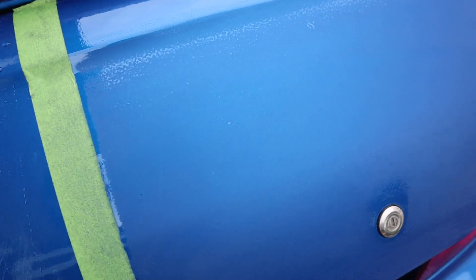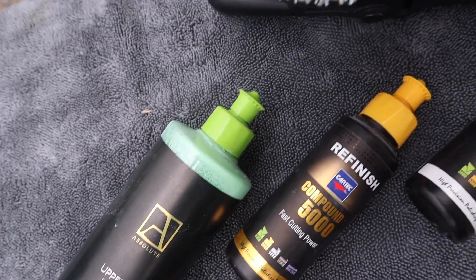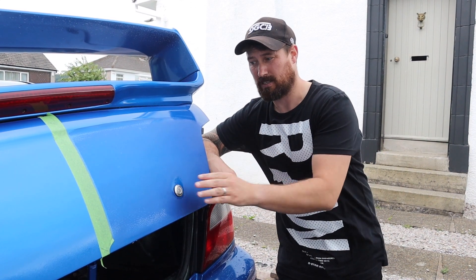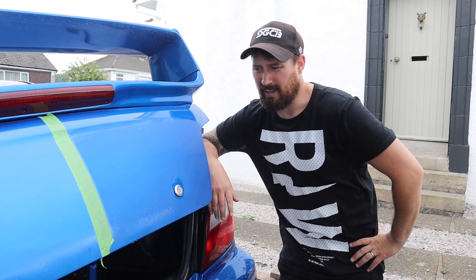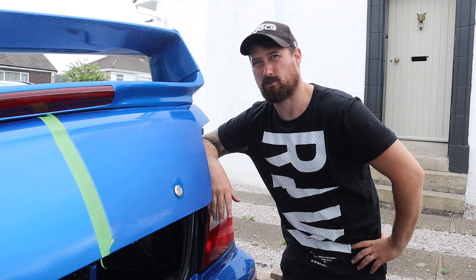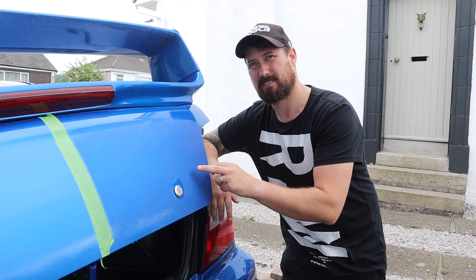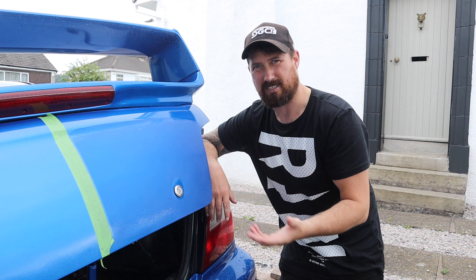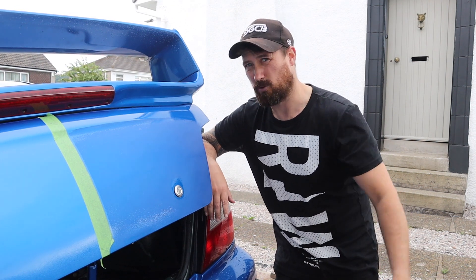Going to start off with Absolute Valeting Uppercut, which is a heavy cut compound, paired with a microfiber pad. A lot of people are probably concerned - I've used 1500 grit three times, 2000 grit twice, 3000 grit twice and haven't burnt through the paint. I haven't taken a paint depth gauge because mine is broken. But this car has got multiple layers of paint on it - the original green colour, then the primer I put on, then the base coat, then the lacquer. It's difficult to tell how much lacquer is there, but because I painted it myself I know I put on a tonne of lacquer, so there should be enough. If not, I'll burn through and have to do it all again - hopefully that doesn't happen.